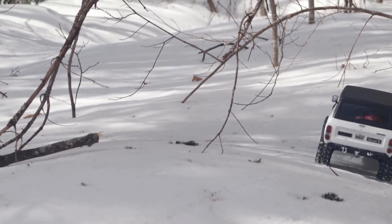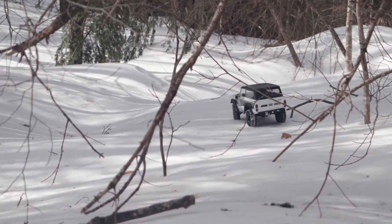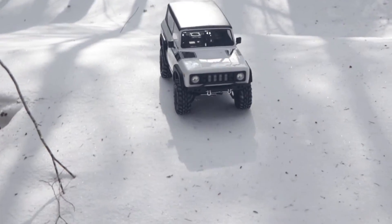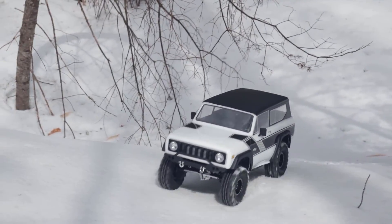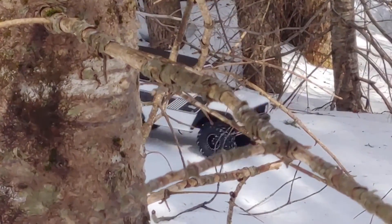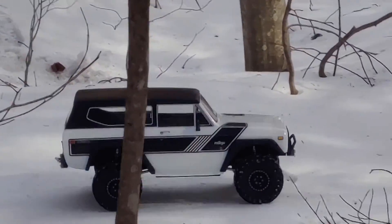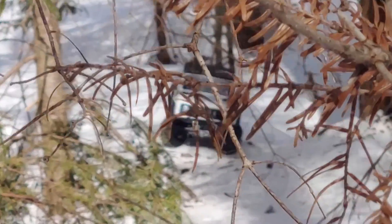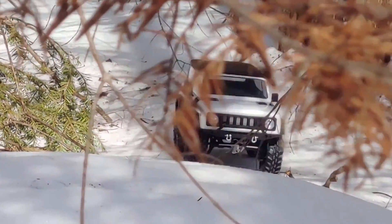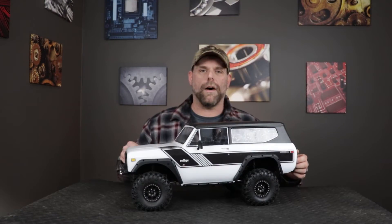Now I want to show you the one change I did make to this vehicle, which was to get rid of the velcro mounting system. Since I got this truck one of the four velcro pads just would not stick to the underside of the body — it came off every time. I put new velcro on and it came off too. I think the problem was too much mold release still stuck to the plastic. If I had cleaned it before putting new velcro on I might have had better luck, but I knew I was going to go with a magnet mount system anyway, so I want to give you a quick rundown of how I did my magnets.